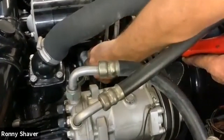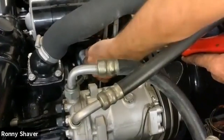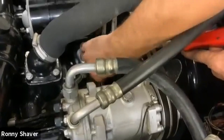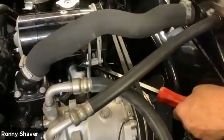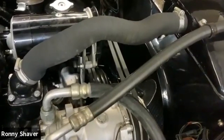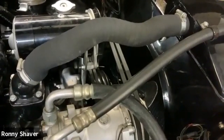With the AC on — remember, the ammeter is not telling you the voltage in the system, it's telling you how much the generator is working. So with the AC on, you're going to be drawing more current to try to keep that system voltage up there. That's why it's pegging — because the generator is working a lot harder.